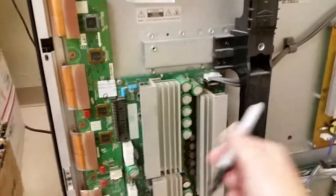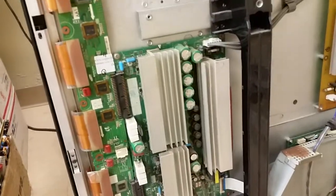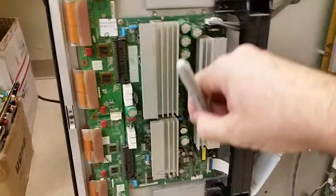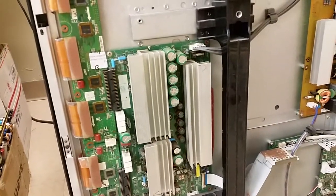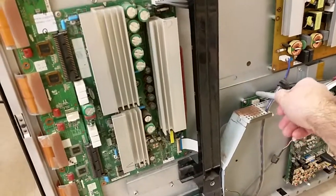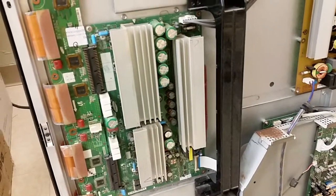As explained in many other similar videos, it's because all those ICs are still old and can fail, because the plasma logic board may be bad and may be causing the failure, because those are also bad. These are 10-year-old TVs, nine years old maybe. We can only guarantee what works here, and because of a few problems we've seen where a bad board causes failures on the Y and the buffers, we can only guarantee that it works when it goes out.